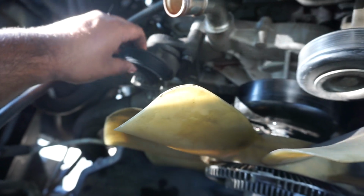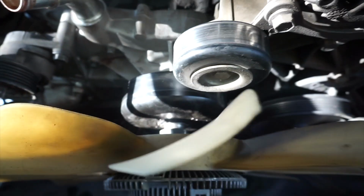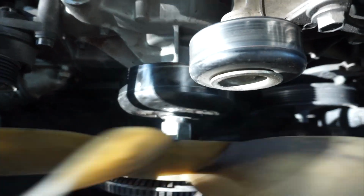Here's my mechanical fan. I took the serpentine belt off, and I'm currently taking off the tensioner. It is not the tensioner, because right now it's loose since I took a bolt out already, but the tensioner is actually really good. But look at this water pump. That wobbles, like it skips a step. So it's definitely the water pump.